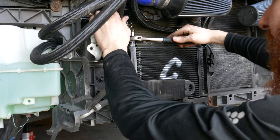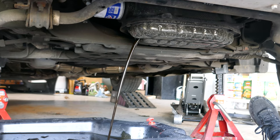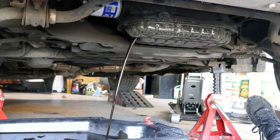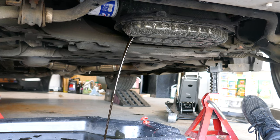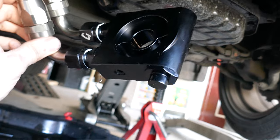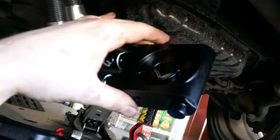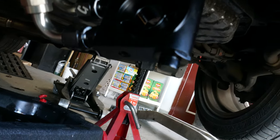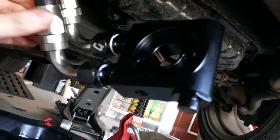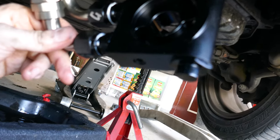than it was originally. Now that I'm fairly confident everything will work, I'm doing the oil change. That'll allow me to remove the oil filter and place the thermostatic plate against it. It's a lot easier to mount the plate loosely first and then to put it in rather than trying to plug in the cables, as they are not going to enter your filter plate at the right angle.